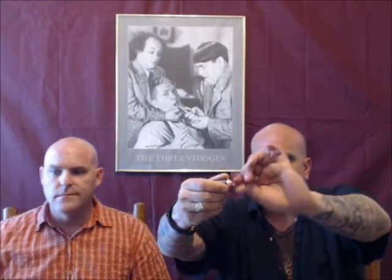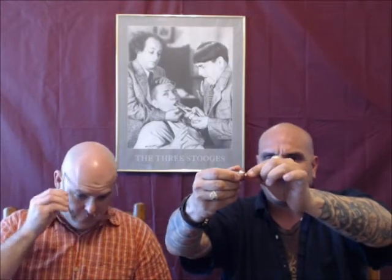Remember, if you're going to rub this on something, screw the contact all the way down so it's not flexing, okay? And you need to clean the top contact and the bottom contact where the fire button is on the inside. You push it out, it's going to poke up a little bit. Scrub it so that it's cleaned off, because if you have a poor contact with your battery, you're not going to get the discharge you're looking for. And then, of course, that's going to be poor power to the atomizer. You're going to have a poor vape.